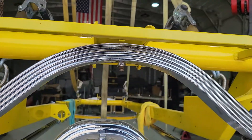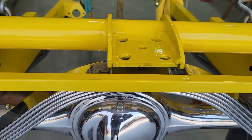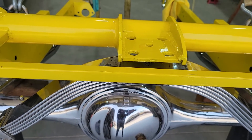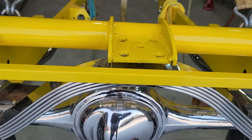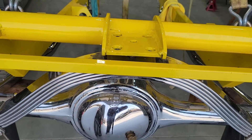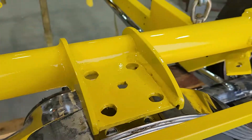I think that'll do the job. It doesn't hurt to raise the back end up another half inch. So if I use a half-inch plate, that's plenty of thread for tapping it and plenty of thread to put the studs in where I want them, and then the hole for the center of the spring — the bolt that holds it all together and centers it up.